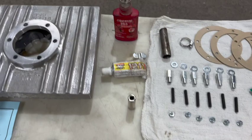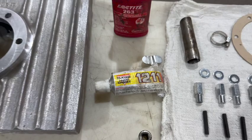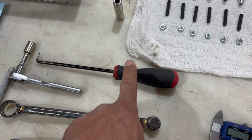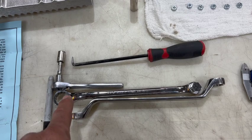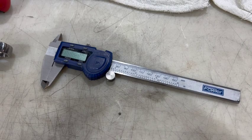Tools we're using for this: we're going to have some Loctite, we're going to have some 12-11 sealant. I use a 90-degree hook for removing the screen if your car has a screen on it. We've got a 10-millimeter for taking your sump plate off, and I've got a couple variations because of the actual drain plug — you've got to drain your oil first. I have them all here: 21, 17, and 19, those are your three most common ones.